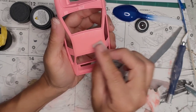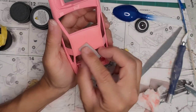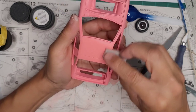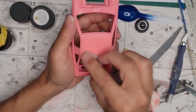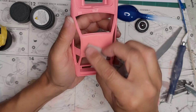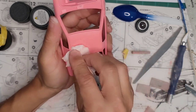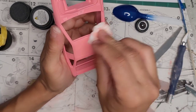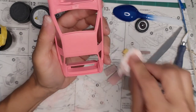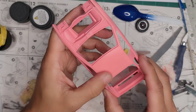As you all know, the problems I've been having with making this roof as smooth as I can, which I think I have finally licked my last issue with this roof. As I'm really liking what I'm seeing now. Now I'm using a 3000 grit sanding sponge to smooth this primer out. And I'm really happy with this roof now. Yep, I gotta think I'm gonna be really happy with it.